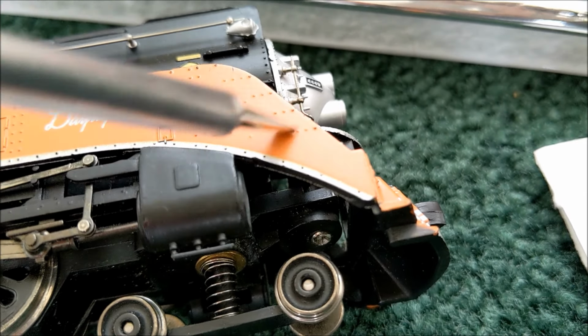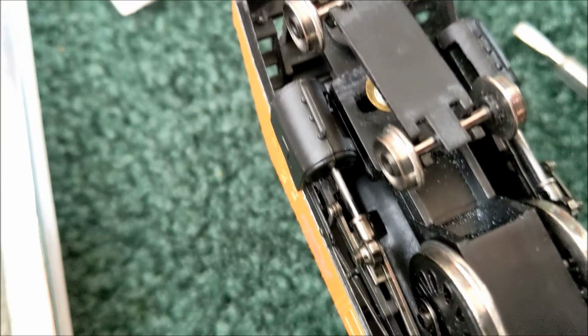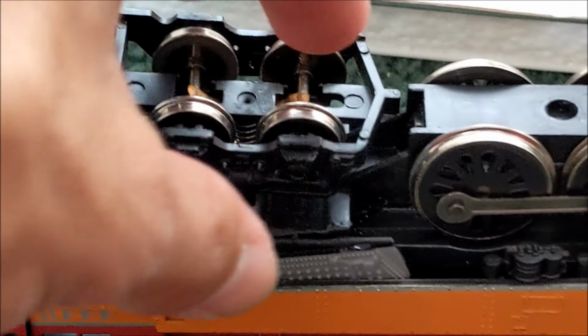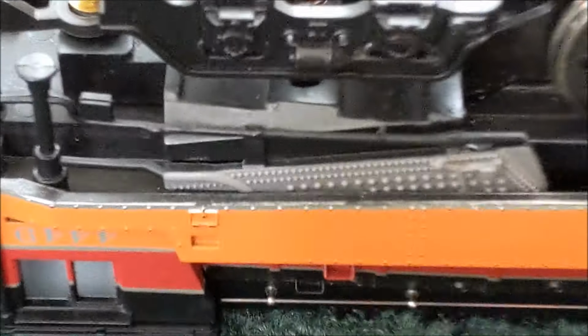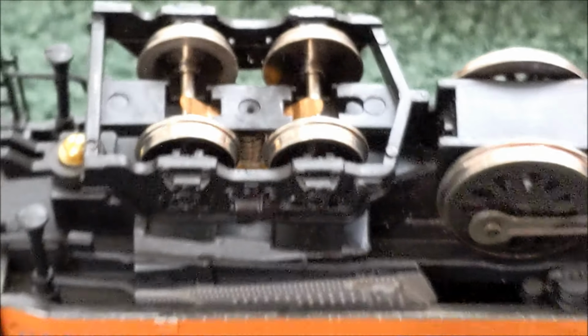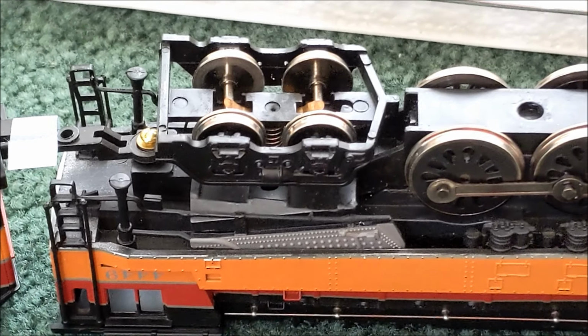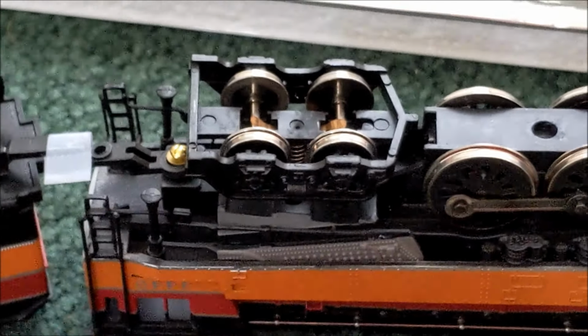Yeah. So if you look, remember the crack I showed you a little while ago? Alex fixed it. That area is where the crack used to be. Oh wait, I forgot, I can just move this. So look, the crack is gone, and he also remolded some of the plastic around this area and this area, because both these things had problems with their pins, and where the screw is in there is where the pin is. He took the original ones off because the plastic was so brittle that it would just peel open like a banana when you screw the little screw into it.